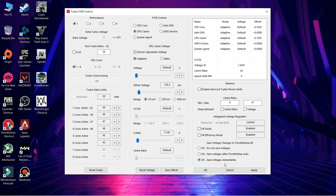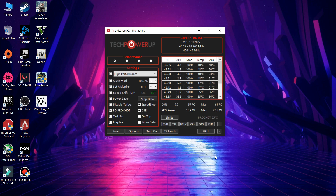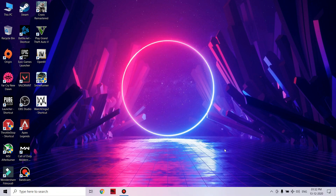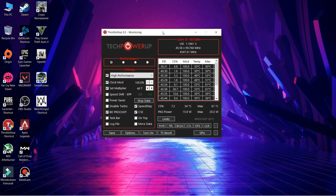After setting the values, click OK, save the voltages immediately, then hit Apply — and you're good to go. Undervolting is done. I also strongly suggest buying a cooling pad, which will definitely help temperatures further. Whenever you want to play a game, open ThrottleStop, minimize it to the system tray, and you'll be able to play with these undervolting settings active.